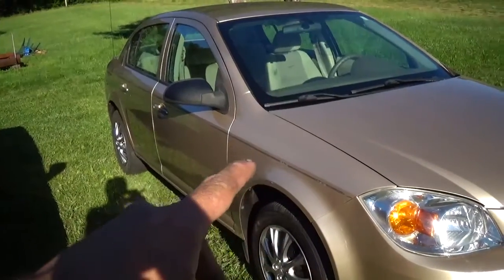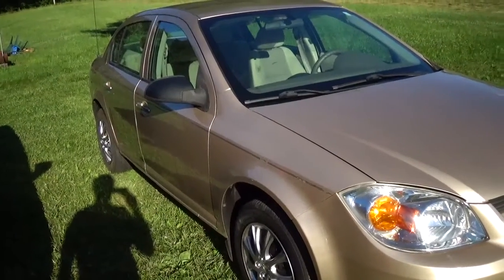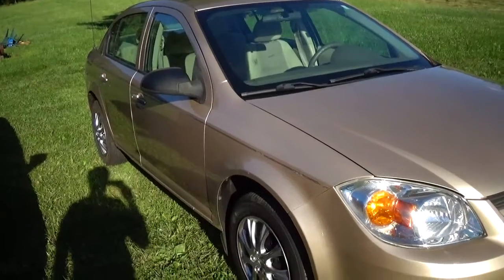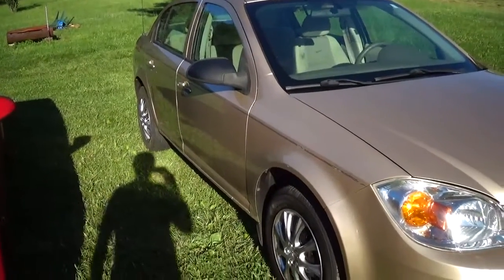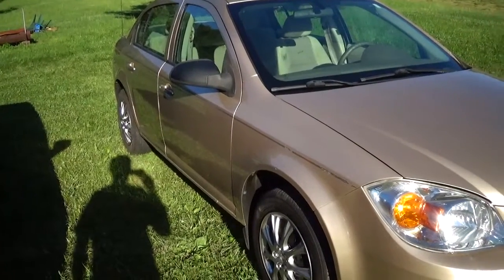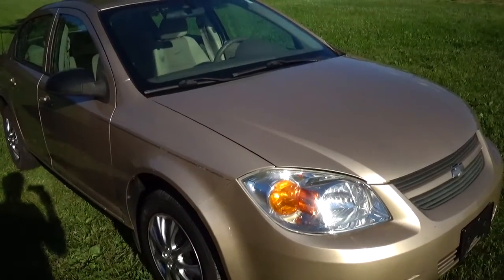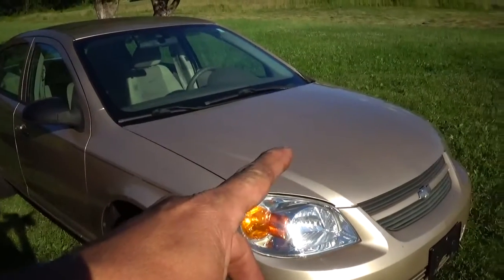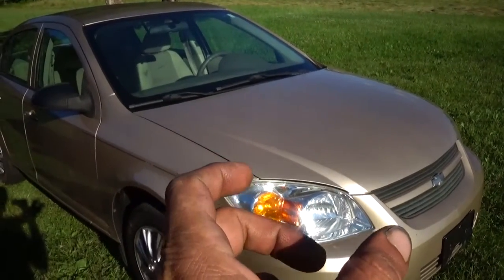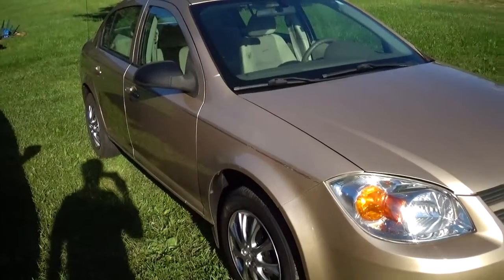When I took it out of the auction I moved it to the front parking lot so I could come back and get it later. Put it in park and walked away. When we went to get it later and put it on the trailer, we discovered it didn't have park either. Luckily it sat in the spot and didn't roll away — there was a $50,000 camper in front of it. When we got it home we discovered the shifting cable, a push-pull cable, had a broken plastic piece right where it goes to the transmission, causing it to kink and making reverse and park inaccessible.